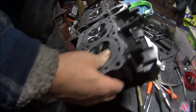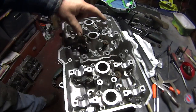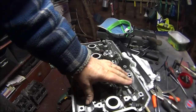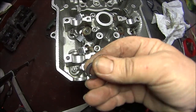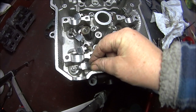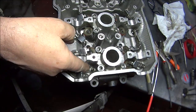Turn the cylinder head over. Trust me to show you how I do it on the hardest valve — these four corner valves. Those two and those two are the hardest valves to do; obviously the central ones are easier because there's more space. Now there are two collar washers to insert first. First we've got the small fat one — doesn't matter which orientation — just drop it in over the valve. Try and get the tap out of the way and drop your washer.